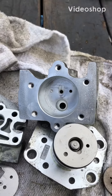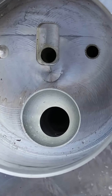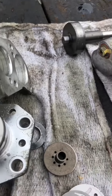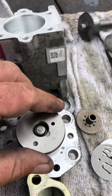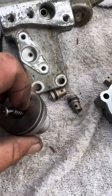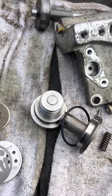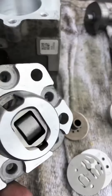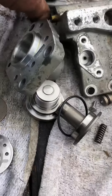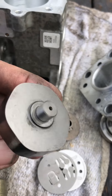I'm trying to figure out what's wrong with this high-pressure pump — might be a little crack right there, not sure. All this looks good, the roller looks good. I think the cam on that looks good — that's the cam that drives the pump.